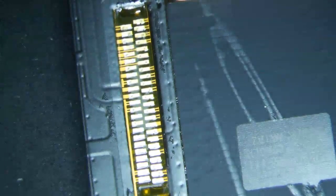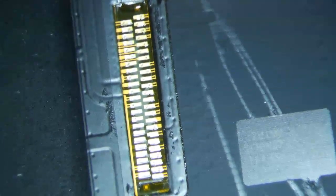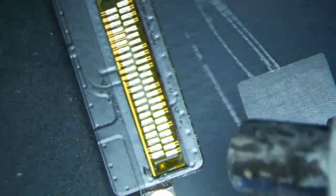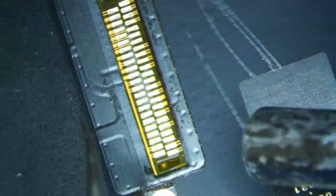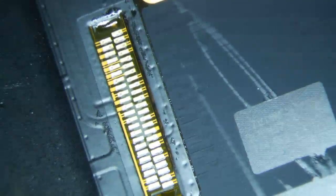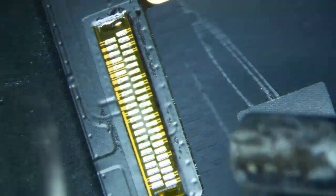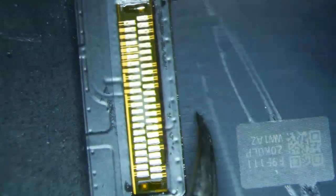The thing about these charge ports is that when people try to do it themselves, they're a little scared of using too much heat — and that's really the thing. You really just have to use enough heat to get this thing off. So 450 degrees Celsius with airflow 40-45 is pretty high heat. I have a silicon mat here from the Hakko soldering iron — you can just use a regular silicon mat. I always direct the heat away from the pads, since there's nothing on the left side — the logic board is on the right side.